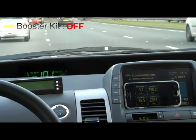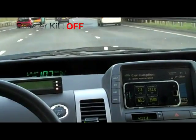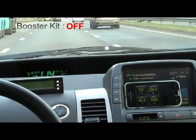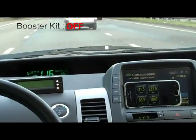The kit's off right now. If the kit's on, the car thinks there's braking regeneration going on and won't allow you to use blended mode at high speed. So you have to switch the kit off before trying to use that mode. We'll do it at the bottom of this straight here, at the bottom of this hill.